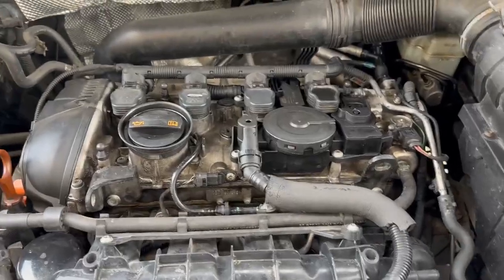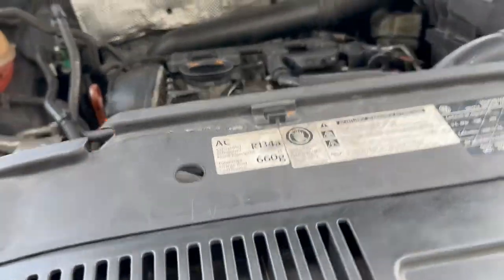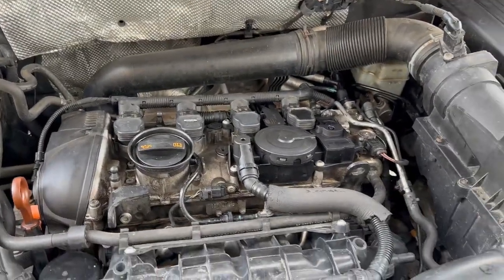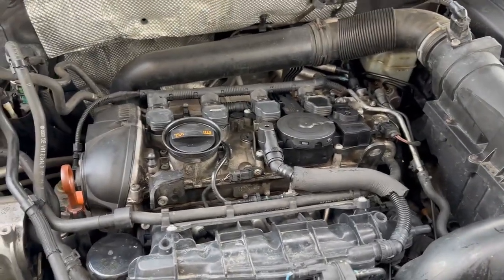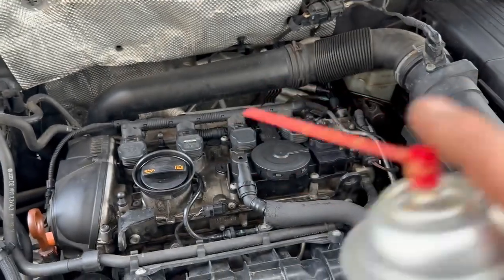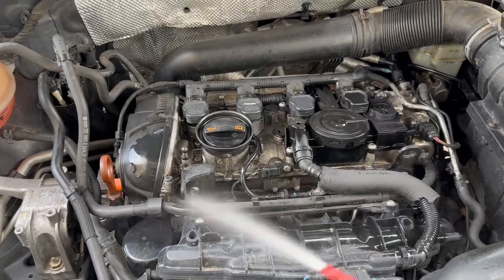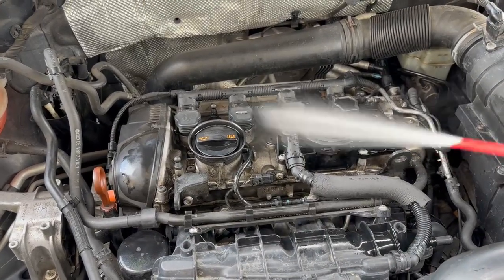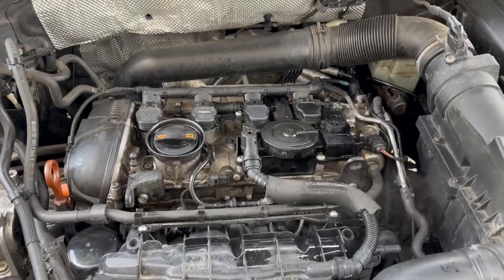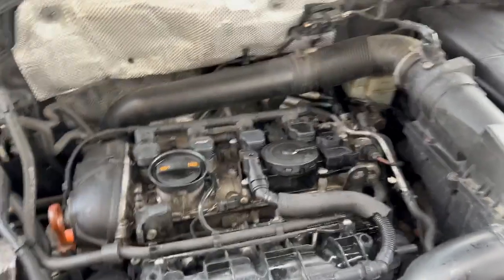The quickest way to check how screwed you are — before you buy small tests and go to a fancy shop — is this: use brake parts cleaner, acetone-based, make sure it's acetone-based, and spray it right here everywhere, a little. No change, still idles rough. That means it's not leaking vacuum anywhere up top. It's good — bad for me, but it's good.